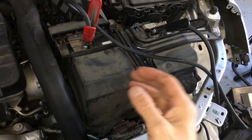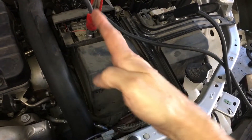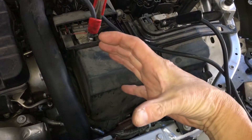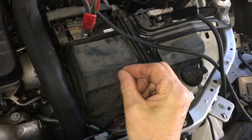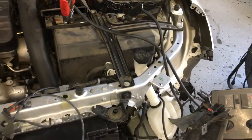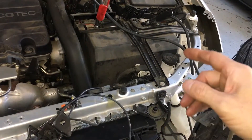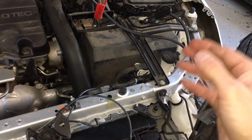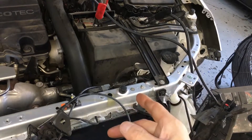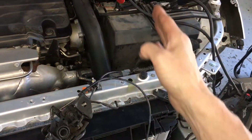You distort the plates inside — they get hot. One plate might distort a little bit, and the plate right next to it will distort as it heats up. The two plates will close and short together and burn out your battery. That's why you guys always end up with dead batteries after leaving a body shop, and then you notice immediately when you get home, or a week or a month later, you need a battery. The guys flattened your battery, hit it hard and fast with a charger, and roasted your plates.